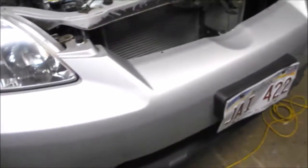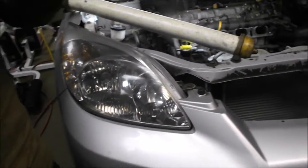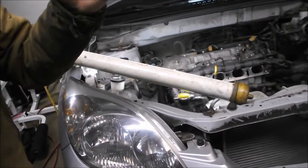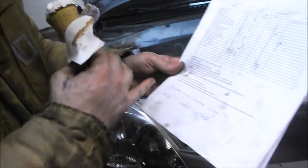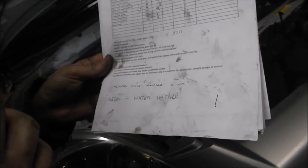They tell you to roll it backwards — that's what would pop it. They give you two options. Rolling it backwards tensions the chain on the normally slack side, which engages that slipper and then the slipper hits the tensioner and shoots it out. The actual wording in the manual says: if plunger not extended, push slipper into the tensioner using a screwdriver to release hook, allowing plunger to extend. So you go in there and jiggle that slipper until it triggers the tensioner.